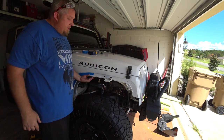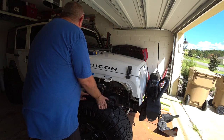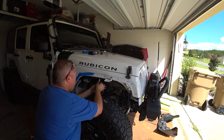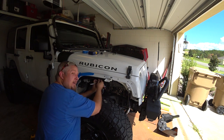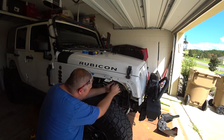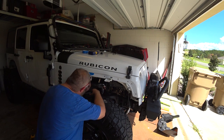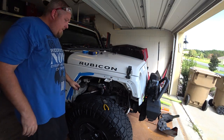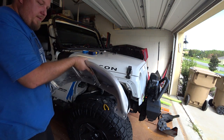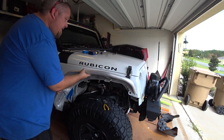These three points and then underneath there'll be three screws that go underneath. You'll use your stock bolts — like the ones you unhooked from all the fender well stuff underneath — and go ahead and put them in now. You're not tightening this all the way up, you're just going to keep it loose. But you want it snug so it's in its final resting place when you mount the fender. Now that that's installed, it's time to put the fender on. This is one of those aluminum fenders from them, and you'll see where this kind of lines up with this.